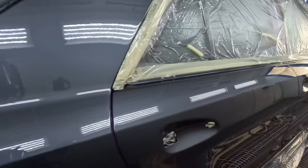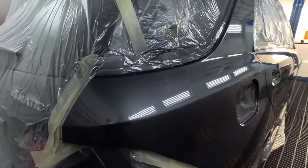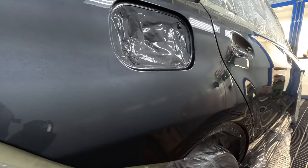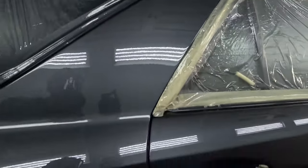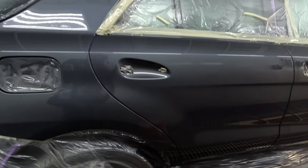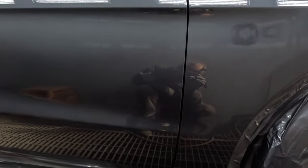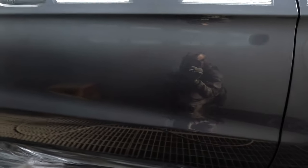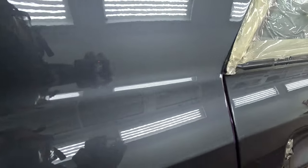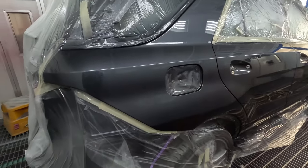Especially these days with fuel and gas prices going up, I think we could be onto a winner with these air-dry clears. Years ago the technology was about heating the booth to ultra-high temperatures with gas-fired infrareds. But if you're the person who didn't upgrade their booth, you've nearly leapfrogged, because the clear coat technology is going ahead of the spray booths and IR technology.